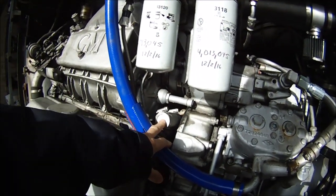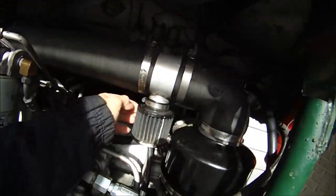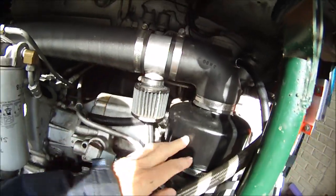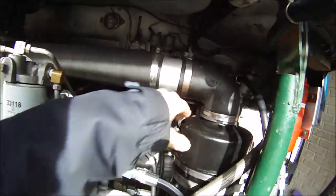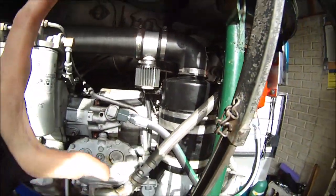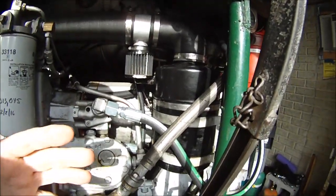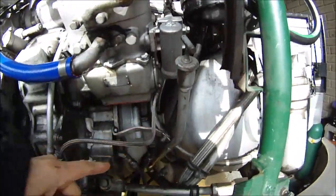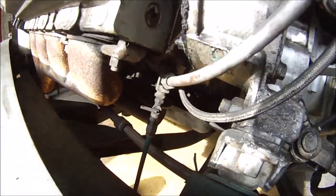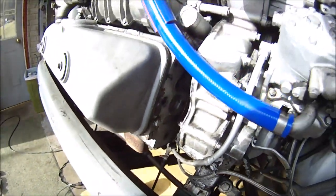This one has been closed off since I purchased the engine 20-some years ago, and would have gone over to the other fitting right here on the back side of this canister. The other hose from the front side of the motor comes over to the canister a couple of inches away. Basically, this is just an empty can. Because the gases have particles of oil in them that condense when they travel through the system, the can allows them to condense and drop down through this tube that goes back down to the oil pan and goes back into circulation.